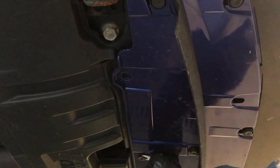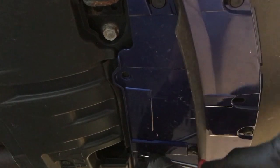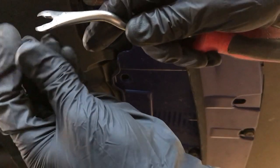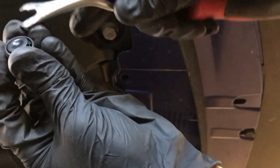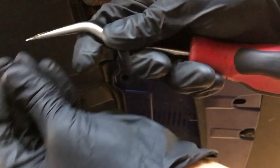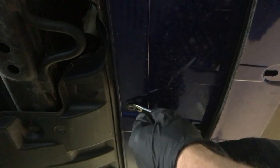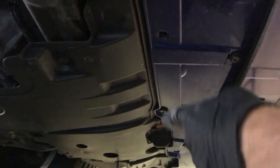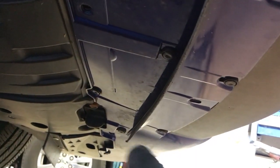These clips on the bottom can get pretty grimy over time. If you have a clip tool you can usually get them out without breaking them. If you're using a flat head, just pry on one side a little bit, then go to the other side of the clip and pry a little bit — work it out that way. If you pry too much in one spot you'll end up breaking it. But if you do break one, that's not a big deal — you can get replacement clips on Amazon too. I'll link to those in the description. All the ones next to the splash shield you want to take out, then do the same down on the end just like we did on the other side.